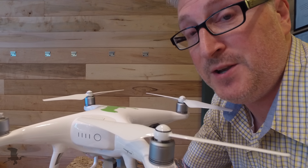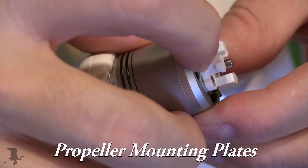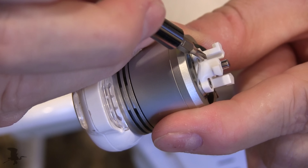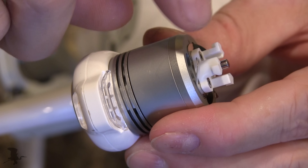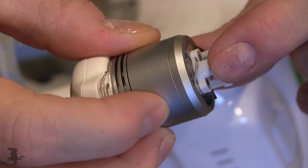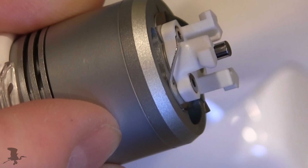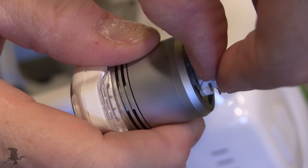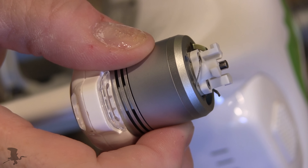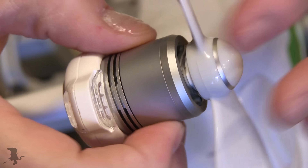Well, no — it's just something that happens over time and you can repair it very easily. These little metal things will want to bend down towards the motor, and you'd be tempted to take a screwdriver and pry it up, but you don't want to do that. You want to use your fingers and very gently lift these up towards the bottom of this bracket. Just like that. Then you move on and do the next one — up just like that, very slight. And then up again on the third one — just like that. That way, when you reconnect the propeller, no wobbling. It's on there good and tight.